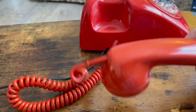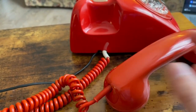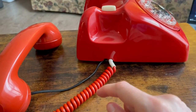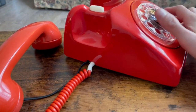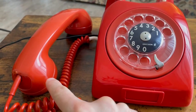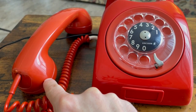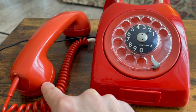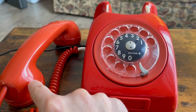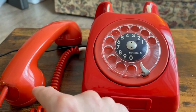The connection is a bit spotty, especially at this restraint — when you move it around too much you lose the connection between the handset and the line. The phone works, but I did have an issue with the transmitter going in and out on me. I had the wires in the wrong spot, but after some rewiring it's got transmission now with no problem. No issue with the receiver, just the transmitter.